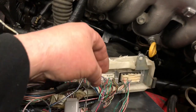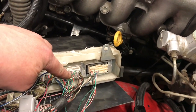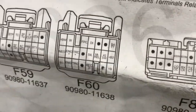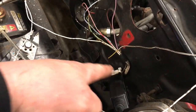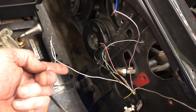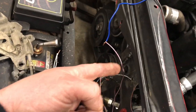Let's start with the OBD2 connector. In the very center of the F60 plug is this white wire with two gray dots on it, right next to the main relay wire. That is the serial data link wire — on the wiring diagram it's right in the middle, labeled SIL. Basically just run this over to the OBD2 connector. Inside the car it's the same color as outside — white with two gray dots — so you plumb those together.